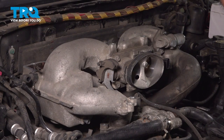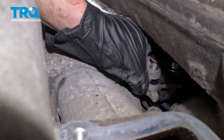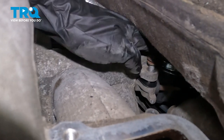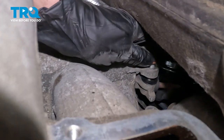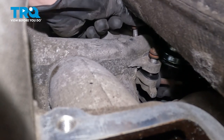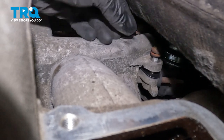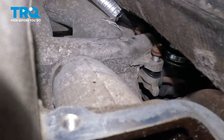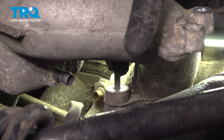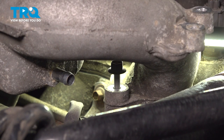Continue on to those two mounting bolts, as I had mentioned. Just flex this around as needed. Should be able to move around a little bit. Okay, that twisted. Starting the other one on the other side here. At this point, we're going to start in all the rest of the intake bolts. There isn't a specific order for starting in the bolts, but when it is time to actually snug them and torque them, it needs to be done in a specific sequence.